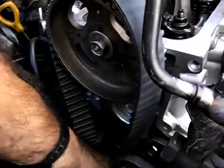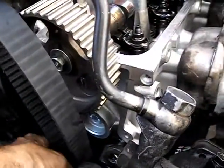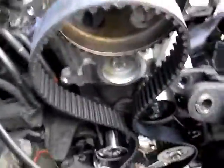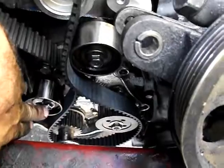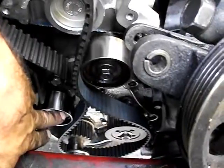When you install the timing belt, the critical thing is you don't want to bend the belt. Get it around all the sprockets and install it. Timing belts can be real difficult if you don't use the right procedure. On your tensioner, you want it as loose as possible — this slot means the spring will pull the tensioner against the belt. When installing, back the tensioner up as far as possible so you can get the belt on the pulleys.